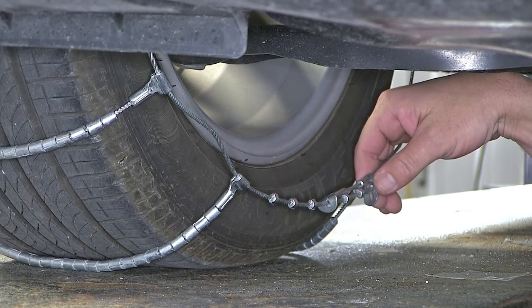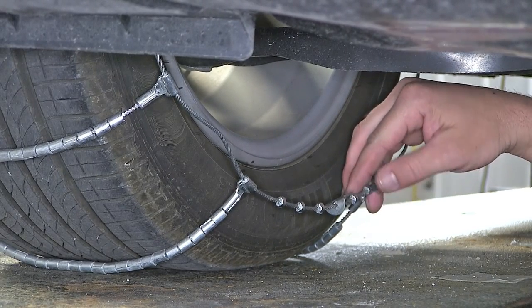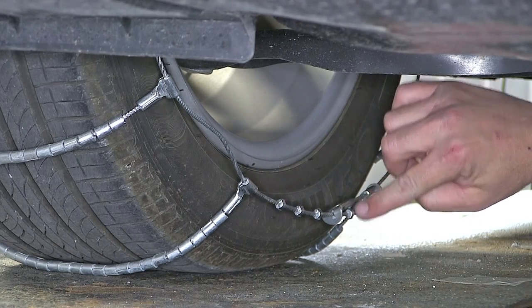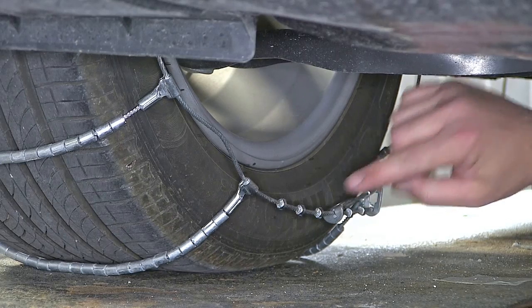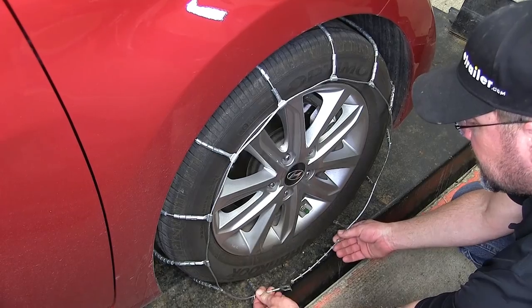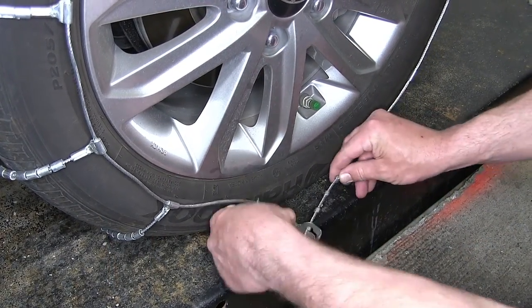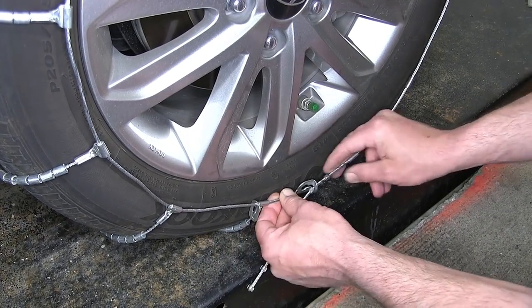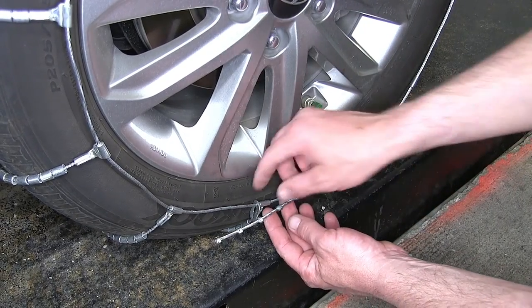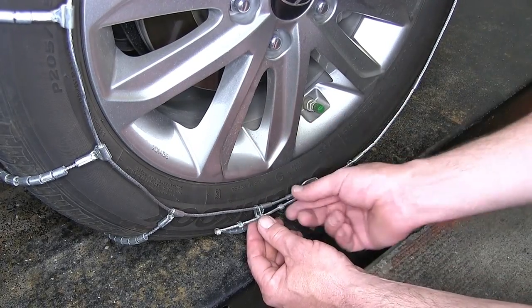Note: if you're not able to attach it to the keeper, you could zip tie it to the cable, or if you're setting up for a specific tire and wheel combination, you could cut off the excess right behind maybe the second notch from where you're going to be hooking it into your cable. Now with our inside secured, we'll move to the outside. Keep in mind that when making cable adjustments, we don't want more than one notch difference between the inside cable and the outside cable. Once we've got it locked in, we'll use the cable keeper to secure the excess.